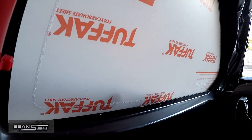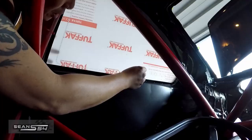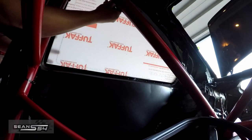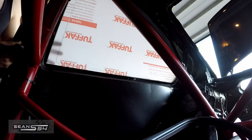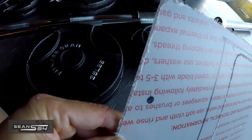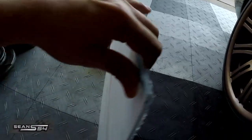I don't have to remove the window frame. I'm going to go inside and use a marker to mark the OEM hole right there and the OEM hole right here, and sketch around the bottom of the window so I have an outline of where I can drill. Here's the outline — that's the OEM hole — and I'm going to transfer that black border to this side.